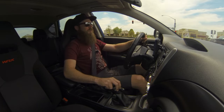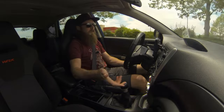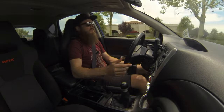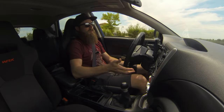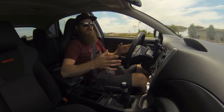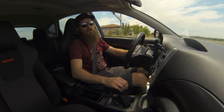I will say that overall it is going to help out on detonation on your car — fine knock, knock learn, feedback knock, anything like that. It's going to make your motor run a lot cleaner as far as a cooler intake charge, because the intercooler is going to be cooling off quite a bit quicker. After that intake charge goes out of the turbo and into the intercooler and cools it off, anything colder is going to get you a little bit more performance.